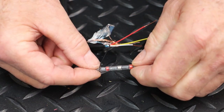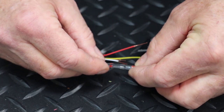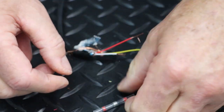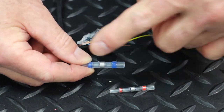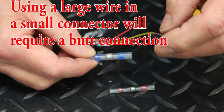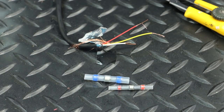Get all the wires exposed, twist them down, and I'll show you how to tin them and make them ready to accept one of these solder seal couplings. This will seal on both ends, and there's solder in the middle that will bond them. The wires go in slightly past the solder joint on both sides — the two wires actually cross each other and go out each end. When you heat this up, it's going to turn shiny for just a second, and when it does that's when you want to stop — that'll melt everything together and give you a nice strong joint.